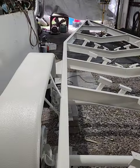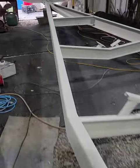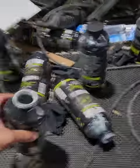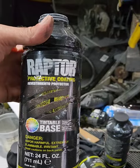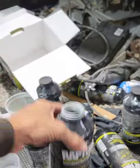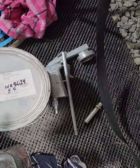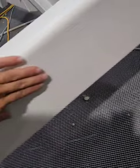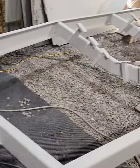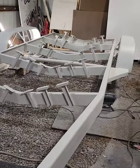Well, there she is. All we did was shoot this with a Schutz gun. We're not sponsored or anything by Raptor Liner, by no means. I've used this product for a few years, and it is some nice stuff. That's all we used. And there's the gun we shoot it with. It shoots a nice texture finish. Like I say, you can pretty much file your fingernails on it once it cures. Rocks shouldn't be chipping this trailer up again.